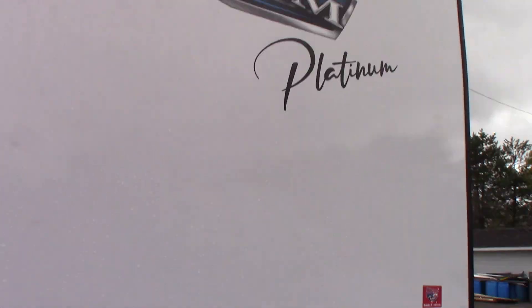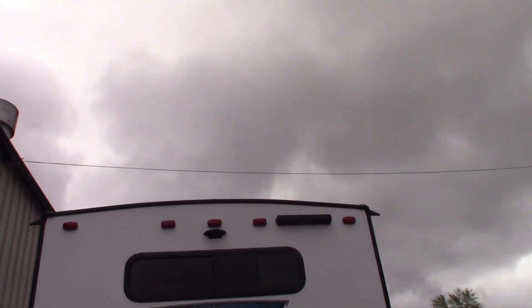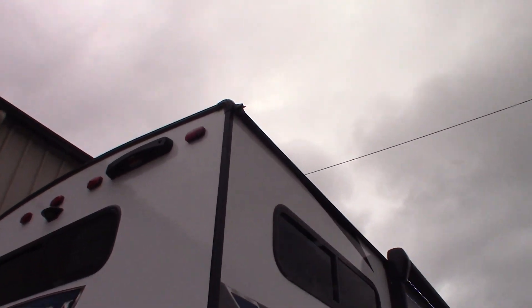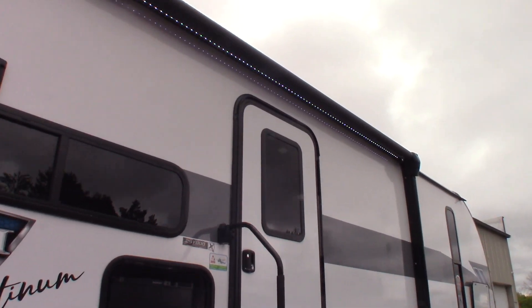This is your bike door — also called a travel door or escape door. You can escape from here and also use it for storage. This housing tells us the trailer is pre-wired for a Furrion backup camera if you want to add one. It's also pre-wired for a Lippert telescoping ladder. The manufacturer recommends inspecting the roof every 60 days — check for cracking or separation in the sealant, and any damage from low branches or road debris. Inspecting your roof should be part of your regular maintenance.